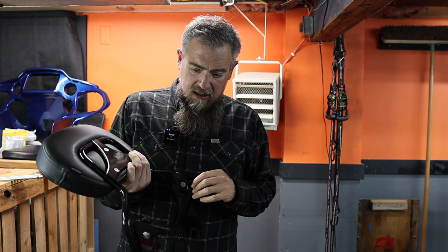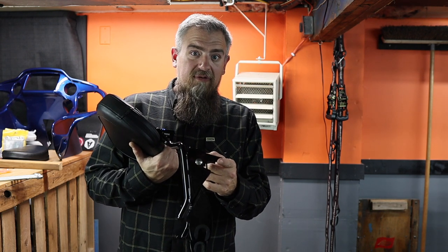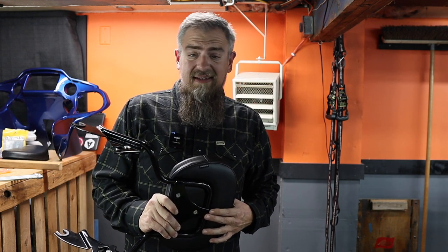The king tour pack is heavy, so mounting it lower might be better anyway — it might be easier to put on the rack. This is an experiment. One of the problems is I've seen people build similar racks but they mounted all the bracketry straight to the wall. My problem is on this particular sissy bar from Hog Works, this tab sticks out quite a ways, so I needed to clear about an inch to get it far enough from the wall. I'm going to use two-by-twos as standoffs to bring that bracketry out just a little bit.